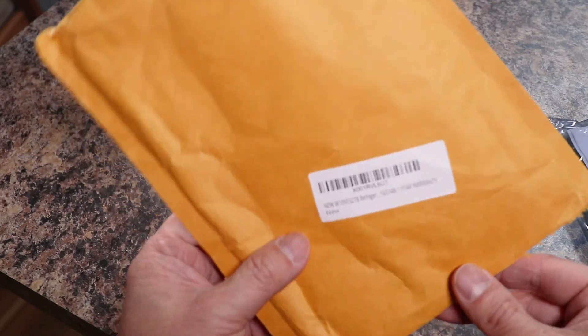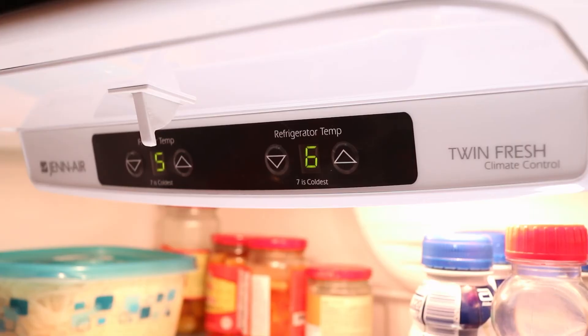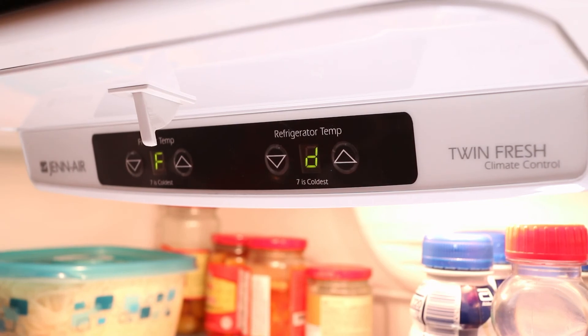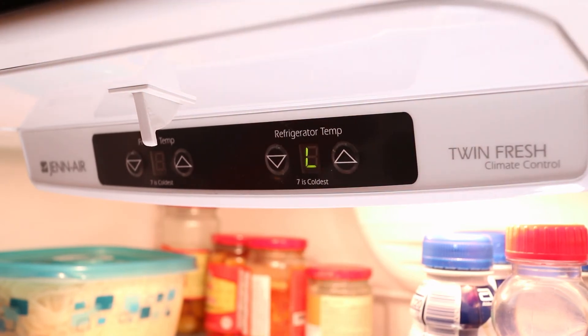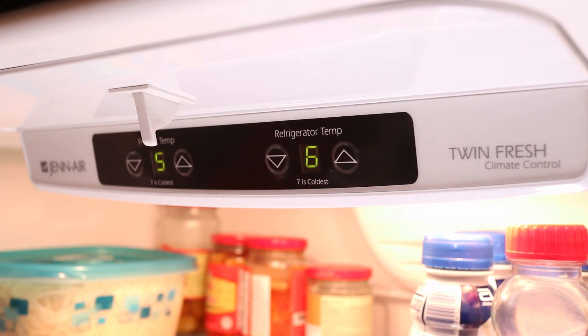In the meantime, while you're waiting for the part to arrive, here's how to force defrost a Jenn-Air and related brands of fridges. Hold the door switch down, then press the Refrigerator Down button 3 times within 10 seconds. The display will show FD for forced defrost mode. Press the Refrigerator Down button once to confirm and an S will be shown — this stands for short defrost mode. Press the Refrigerator Up button to change it to long defrost, which I highly suggest. Then press the Refrigerator Down button and the display returns to normal, and the force defrost cycle starts. Close the door and repeat as necessary later in the day.